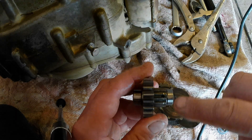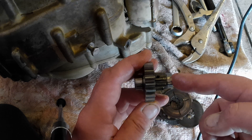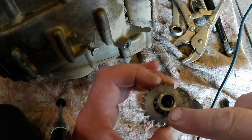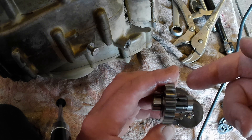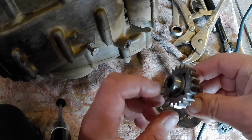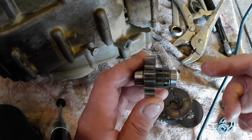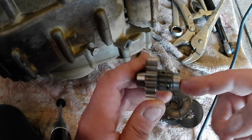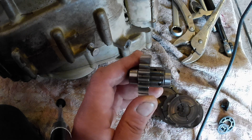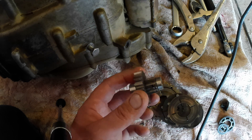On this shaft you can see the oil holes — you've got one there and at 90 degrees opposite you've got another one there. The torque limiter shaft itself you can't see all the way through because it's got a restriction just in front of where this smaller gear face is. Like I said, it's got four holes which correspond to those slots. So the back half allows gases to flow through and out of the engine, while the other side collects oil from within the engine and under centrifugal action forces oil through these oil ways in the other components — lubricating them but more importantly, I guess, cooling them.